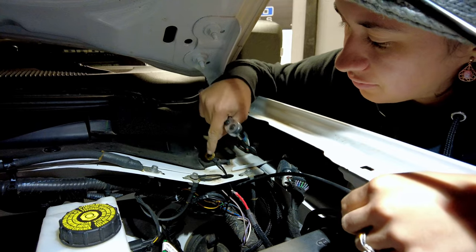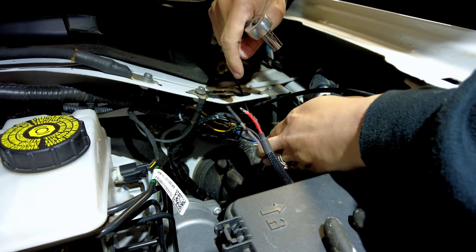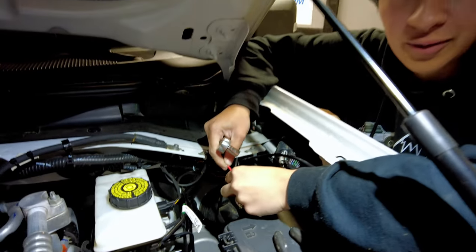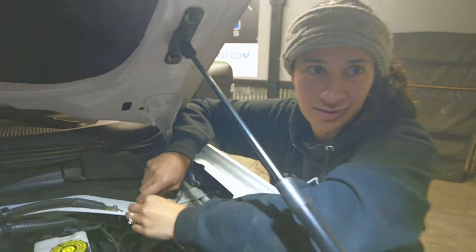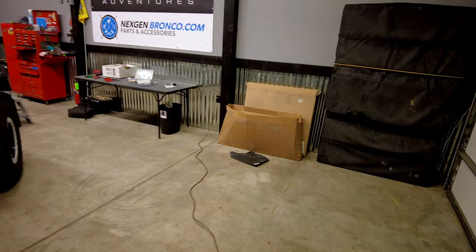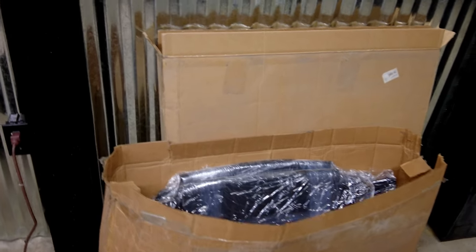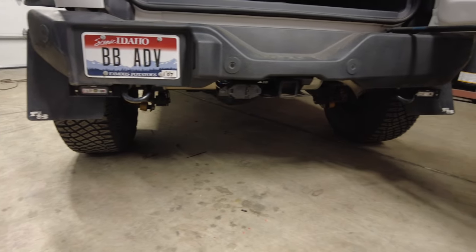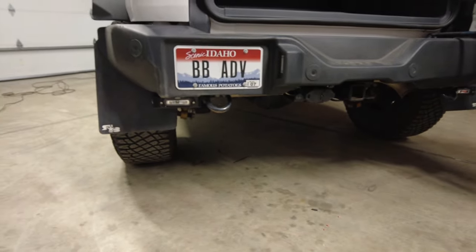We're attaching the ground right here next to the auxiliary wiring. The power for this goes to auxiliary four, which is the brown wire right here. In theory, when we hit the button the rear lights will be bright white. Spoiler alert — we've got boxes coming for an install video, it's gonna be awesome. The lights are there in the danger zone and they actually look pretty good — you don't immediately notice them, which is nice.